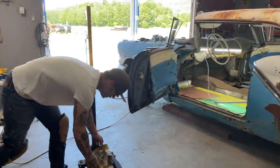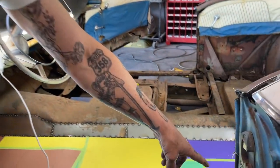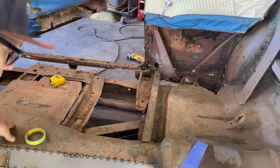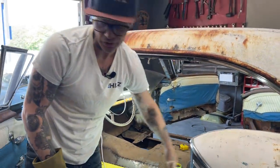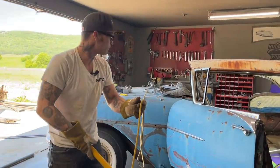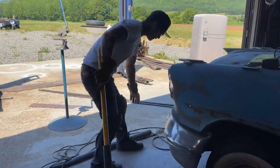As I see, I got this side in here, the piece that goes along back for the seat, the square piece that goes over the side. You can see where it is, and you can see where it was attached to our support on our quarter panel, underneath the seat brace right here. I'm talking about this piece right here. That's a seat brace. That's where the seat sat down on. You could bend a piece of metal up on the old brake over there and set it down on there and weld it to that floor very, very easily. Jim was talking about wood. That could be very easy too, but to make it look professional or halfway more decent, you could put a piece of metal in there. Just gonna tow this over there.